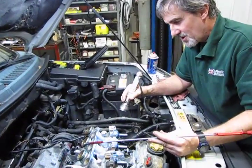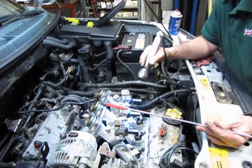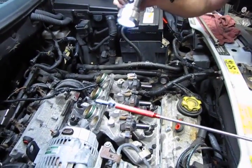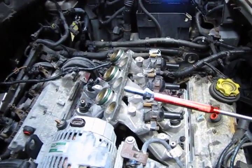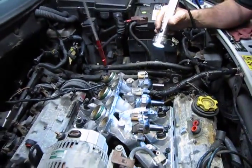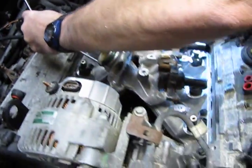Alright, before I torque this up, I just wanted to show this one little trick as far as how to get the bottom bolts into this front manifold. So you'll see this is that little grabber tool I had shown you earlier. And with the bolt clamped in place, you can see all four fingers are grabbed right around it so that it's concentric. And essentially sneak right in from the back. You've got an open hole in the manifold right there.